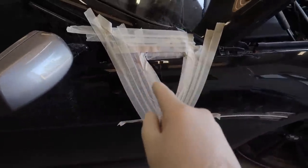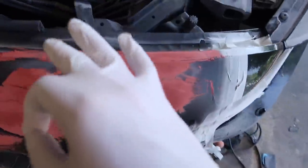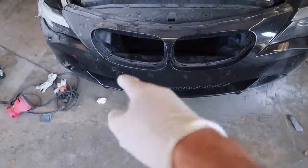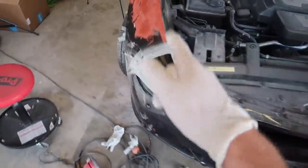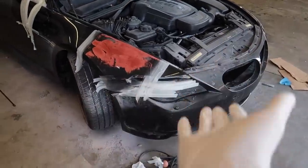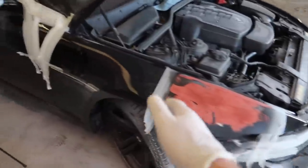We're making some good progress. I have this thing fully masked up — I know I use a lot of tape, I don't really care, it's Dollar Tree tape. This is slightly not leveled — I still tidied it up from the back but it needs some bondo to level out in the front. Same goes with this side — I just used some putty to make it perfect. I already used bondo and that's good. The front, I just need to sand it down. I got rid of all the holes and everything. This side, I perfected the issue that we were having. I think this bumper is really coming together. I think this fender is really coming together. It sucks that I had to pay for these two and still have to fix some — it's just because of how hard it is to find these parts. But I'm really happy with this. Let's go ahead and finish up the rest of this fender.